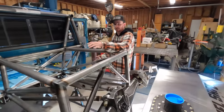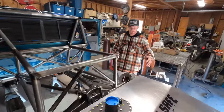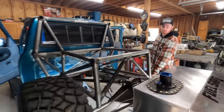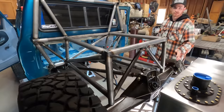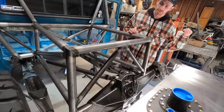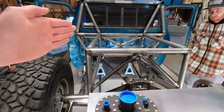Since this is not being built on a fixture table, I knew the truck is sitting at ride height right now on the jack stands. I brought the axle up 14 inches of up travel from where it's sitting on the stands. There's about an inch to an inch and a quarter more that needs to come off — it's just there as a standoff to build off of. So realistically this thing has about 15 inches of up travel from ride height. The B pillar got put in and then this section — the top tube, side tubes, and these stringers, I built all this on the bench.